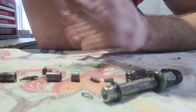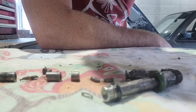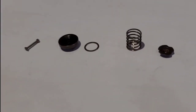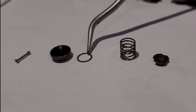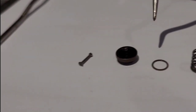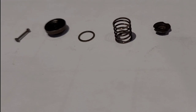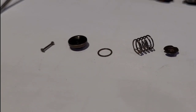I'll take some detailed pictures so we can see clearly. Here is what you're looking at - this is the actual injector parts, the only bit that works. You've got your seat, that's your actual needle pin, that must be some sort of shim to regulate the pressure on the spring, and that's just your retainer. Tiny little bits. You only need a bit of carbon - like your valves get carboned up - a bit between that surface and it won't seal. Or that spring gets a bit weak and it opens too early. That's the inside of a KJet injector.